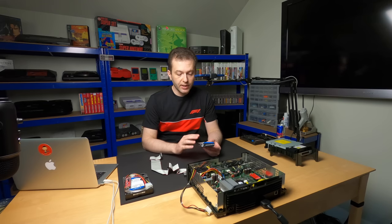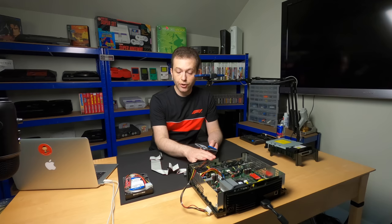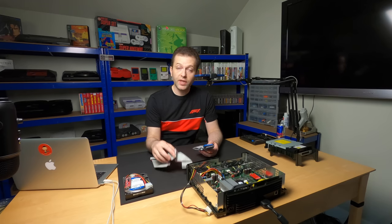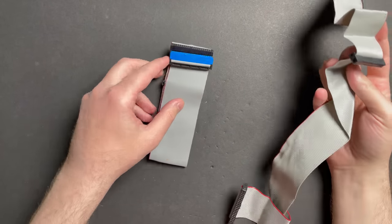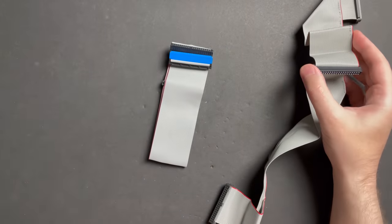Whether you're using a 24-inch cable or an 18-inch cable, there's a bit of an art to folding it so that it's going to fit neatly inside your Xbox. And you would think you could just mimic the folds on the original cable, but you can't because it's backwards.